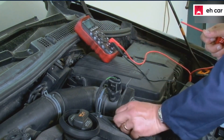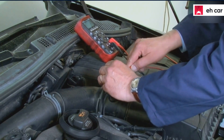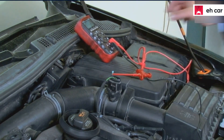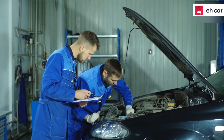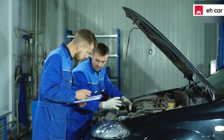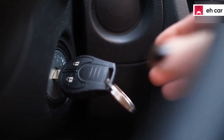If you didn't turn on many components, do so and examine the reading again. If you observe little or no change, then contact an expert to examine your alternator. Once done, you can now turn off your car and close the hood.